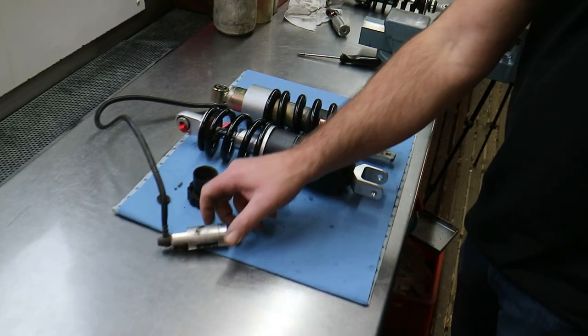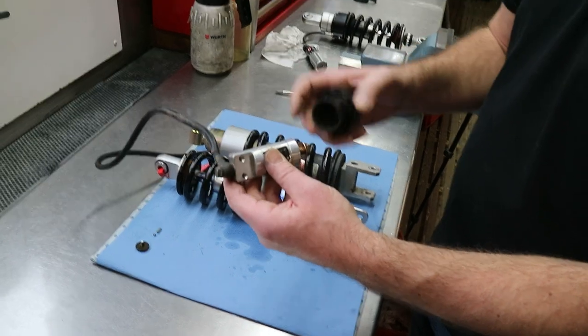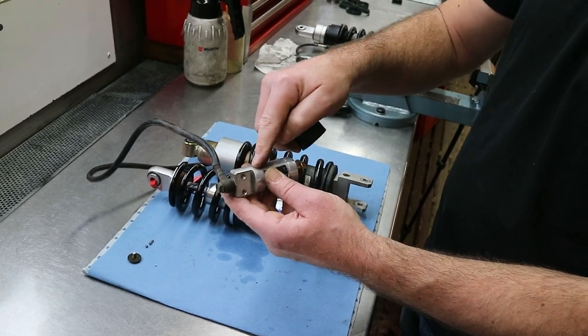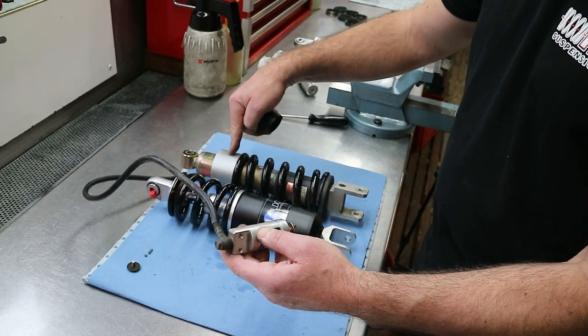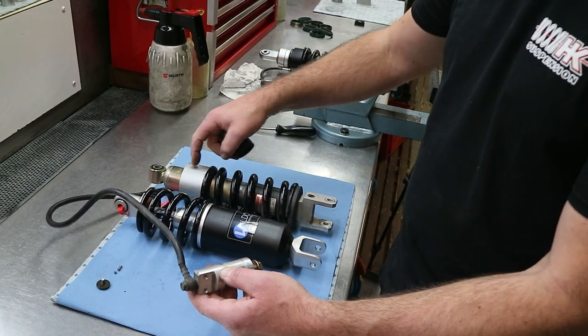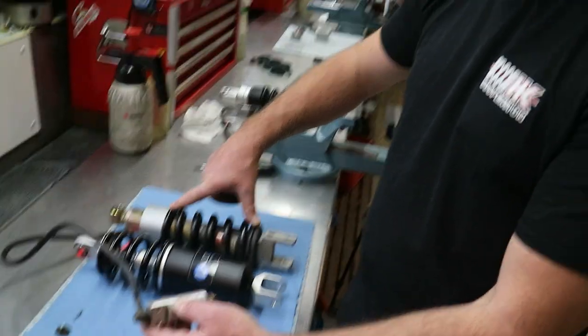As you can see, this one has a hydraulic function. Herein is a cylinder and a piston. When you turn this knob in or out, the piston is moved in. It compresses the oil through the hose in this cylinder and pushes the spring right in, or lets the oil flow out, and then the spring goes back to its original length again.